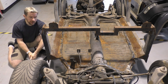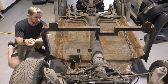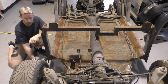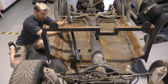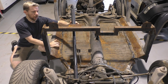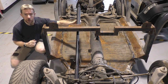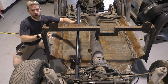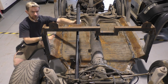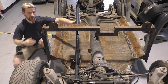Another problem which will need to be sorted is the steering column. We have the issue of the alignment — where if you turn the steering wheel, the outer sheath would foul on the inner tube. The alignment issue is mainly due to this section here not lining up properly with the column. Borrowing Mr. Daniel's jack handle here — we put that like so. You can see there's a fair bit of play in between where we can have it. That is roughly where it should be, but the plate starts all the way over here with next to nothing over in this section. This entire box will need to be removed and shifted over in order for it to line up properly so I've got enough material. If I try to bolt on at the moment, I'm only going to have one side — there's not enough material on the rest of it to do it properly.